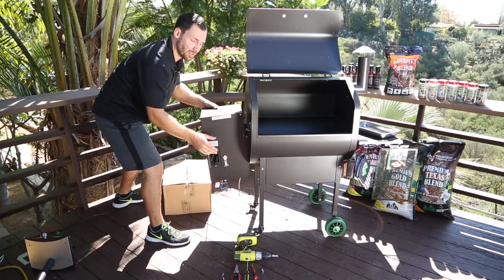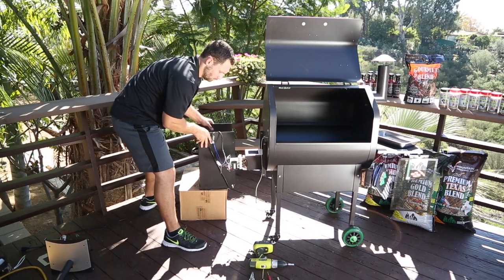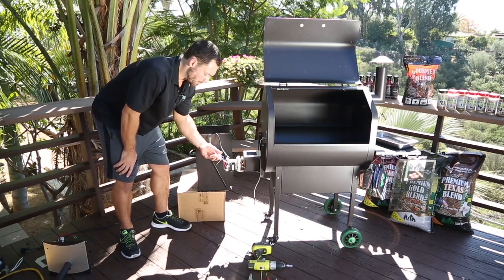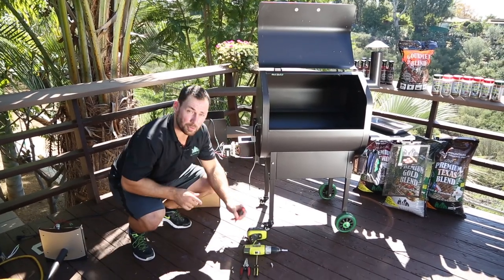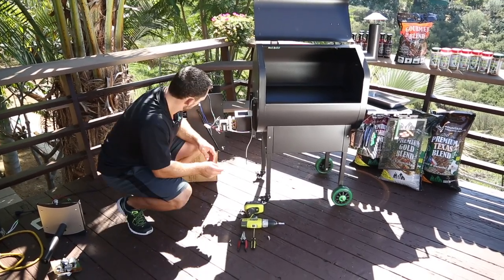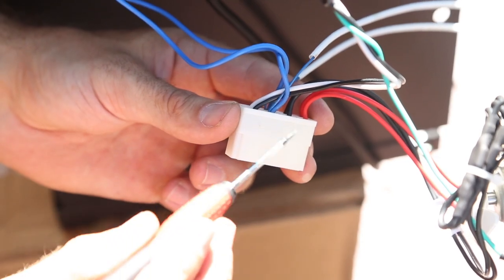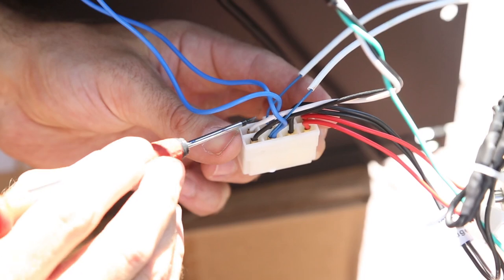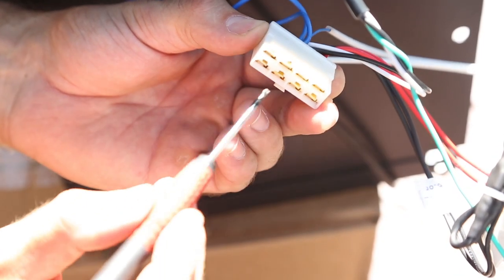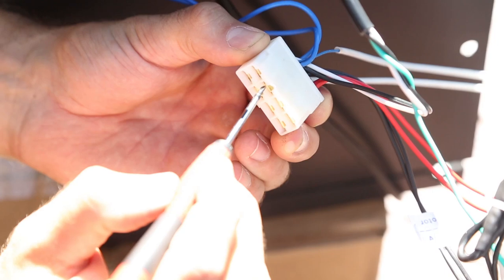Have a box or five gallon bucket ready to flip the hopper box onto. Next, we're going to remove the blue wires out of the main wiring harness. In order to do that you're going to need a micro driver or a bobby pin — something small and long that you can use to depress the little clips. We're going to remove the blue fan wires for both the combustion and the hopper fan. They're shared and go into the same slots. Take your micro driver and depress the little tabs on the inside of the plug — there are small square notches where you insert the driver to press the tab and then they'll slide right out.